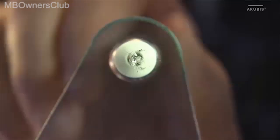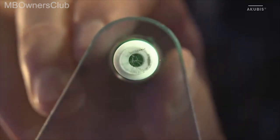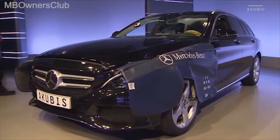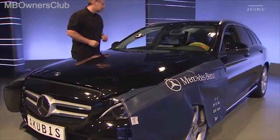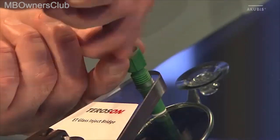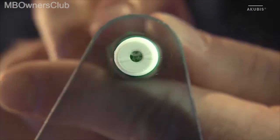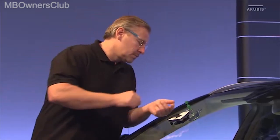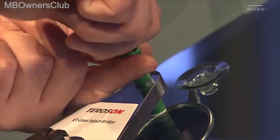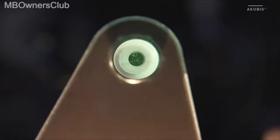Screw the injector into the tool holder until it is firmly positioned against the front windscreen. The center point of the seal must be in the center of the damaged area. After a short period of time, carefully screw out the injector. While doing so, apply pressure to the piston. During the vacuum phase, the air is drawn out of the damaged area. Repeat this process until the damaged area is clear and without any enclosed air bubbles. Wait several minutes between each pressure and vacuum phase.